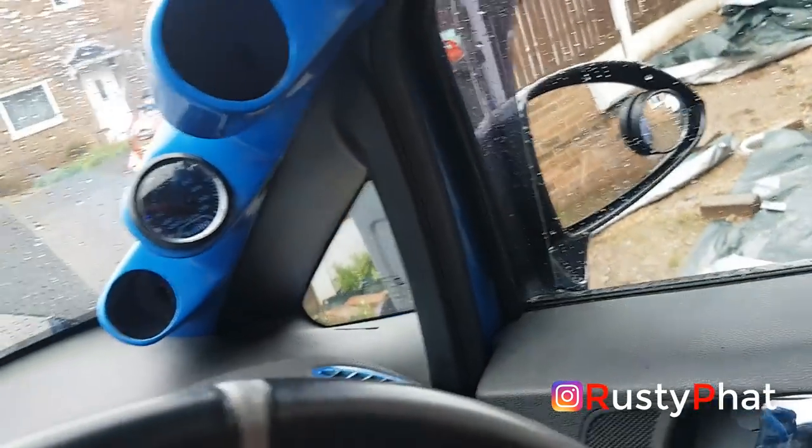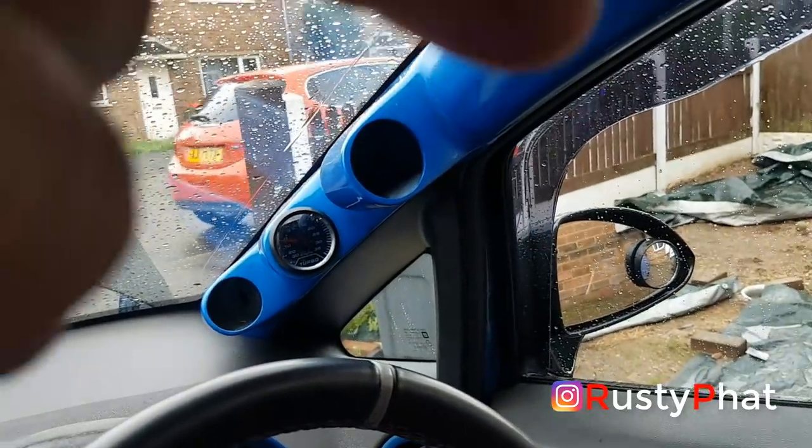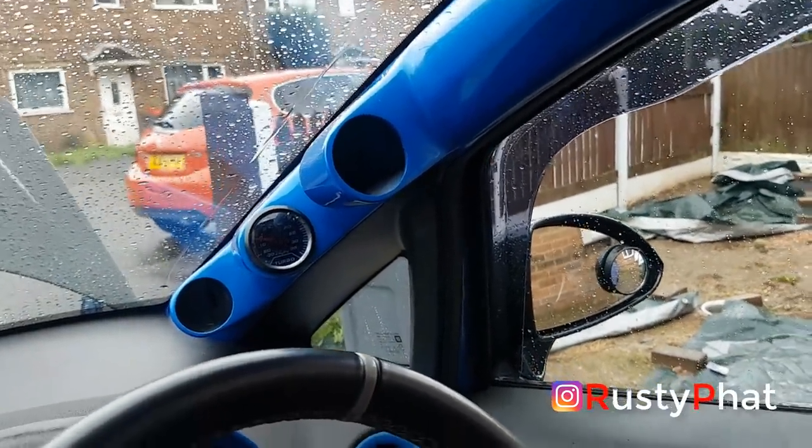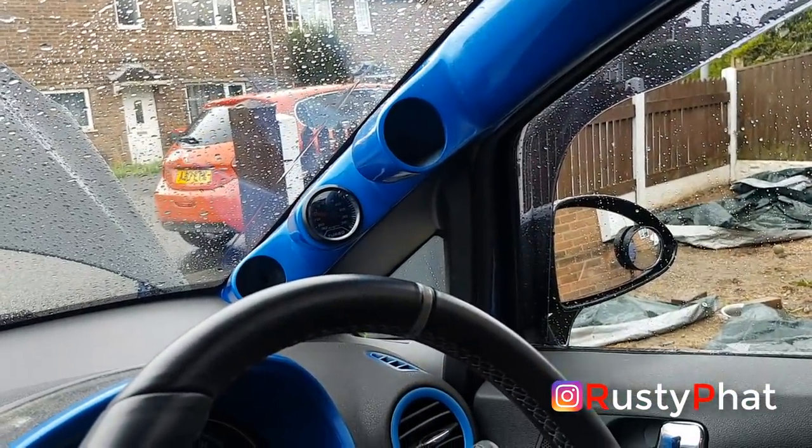That's then been routed underneath here, all the way under these panels which were taken out, routed through and back through this side, all underneath here, all nicely tucked away. Then it has literally come through this little socket here - it's come up this bit on the other side and then gone down here through all the appropriate connections for the boost gauge. Same with the electrics - it's been earthed to the bolt just underneath here. All wires have been routed up through just here on this side, and then to the back of the boost gauge. That is pretty much it - that is extremely simple. It's going to allow the boost gauge to come on when you turn the key in the ignition and not be on all the time. That has been tested - you want the third one down on the right-hand side. Extremely simple install, just very fiddly to put in. Thank you guys for watching - like, comment, subscribe, and I'll see you guys in the next one.